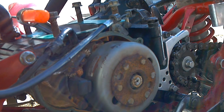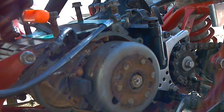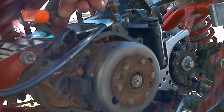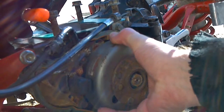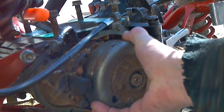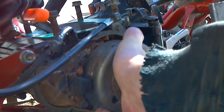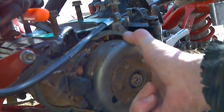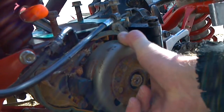I'm checking the rod for end play. What I did was put a plastic screwdriver right here through the rod, holding it down and pushing down on the rod in between the two front jug bolts. I'm trying to turn the flywheel and I'm not getting any movement at all — none. If I let it go I can move it, but if I hold the rod down and make sure it's centered, there's nothing.